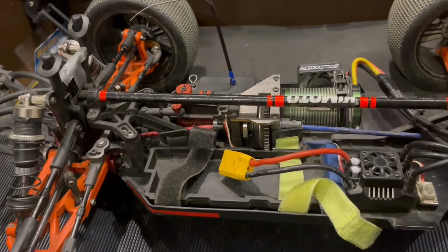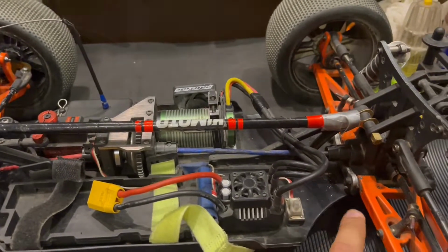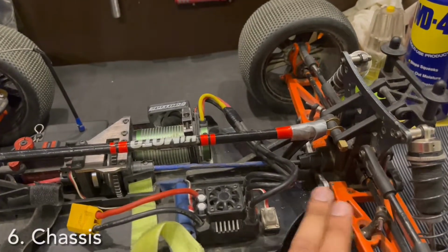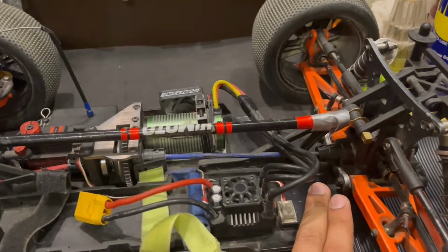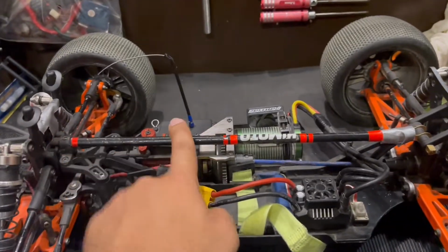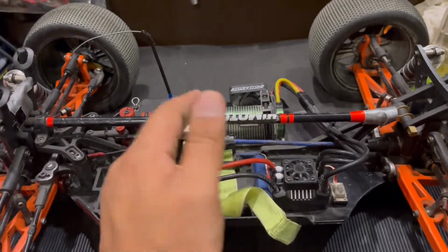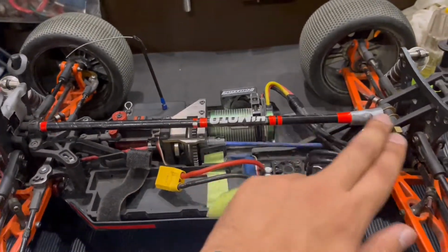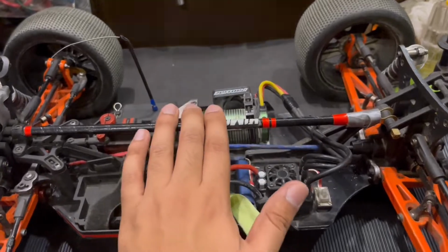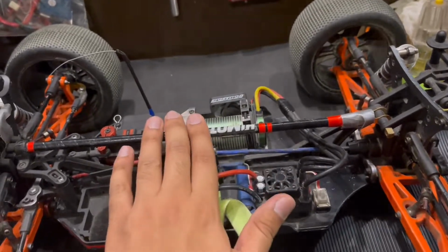And last but not least is the chassis. Now the chassis is good. It doesn't bend easily, but if you're obviously bashing hard, doing stunts and all that stuff, you can keep an eye on it. To avoid that, put a chassis brace on top. This is a good option, as you have seen on other cars like Arma or Traxxas. Even the Traxxas Slash now has that chassis brace on it, because it strengthens the chassis, and removes the flex and the bending. So definitely consider this option, and if you don't know how to do this, you can check that on my channel as well.